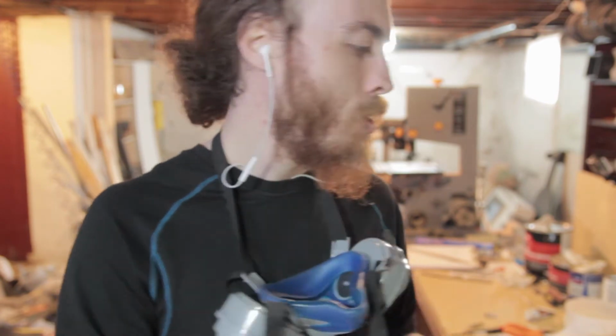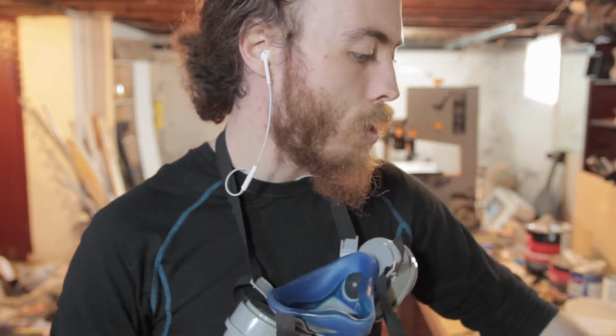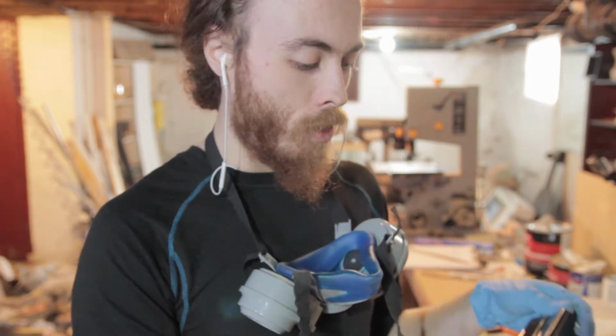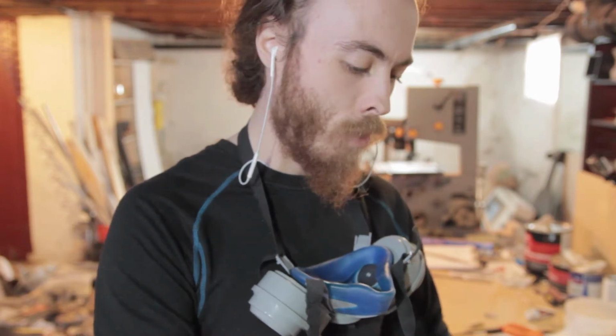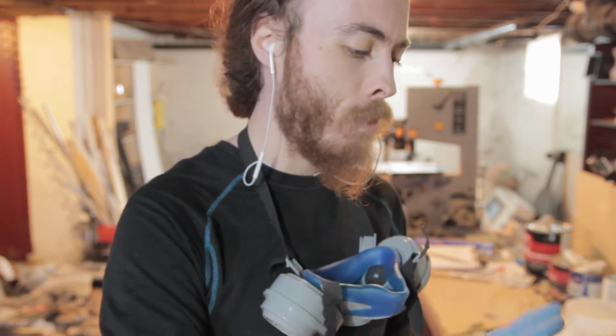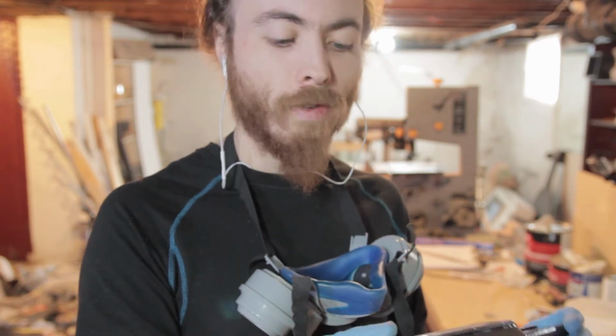Between those two steps, I move up from around 320, 400 grit, around there, to more like 1000 grit. And just before I put the gloss coat on, I go over it with 2000 grit, because I did an A/B test, and the clear coat over the 2000 grit was definitely smoother than the clear coat over the 1000 grit. For some reason, it didn't seem to me like it should make a difference, but there you go. I guess I'll take a look at that later in the video when we get to that kind of stage.